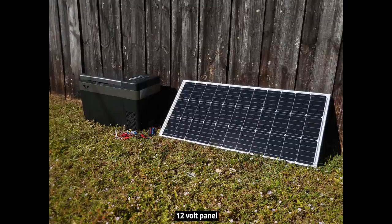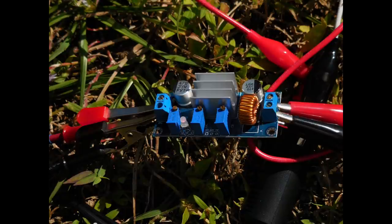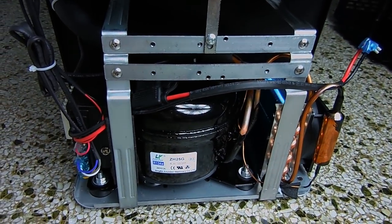For solar operation, you need at minimum a 60-watt solar panel to handle the startup surge on Max Cool. You'll also need an inexpensive high-efficiency 5-amp step-down converter, with the regulated output set between 13 and 14.5 volts. Here's what the unit looks like with the cover removed — the wire connects to the back side of the cover, and the 12/24-volt input is located here with a fuse holder containing a 15-amp fuse.